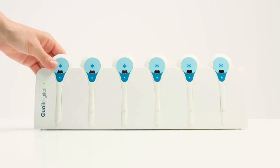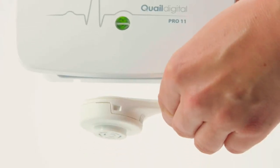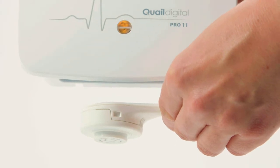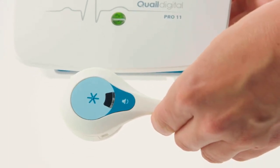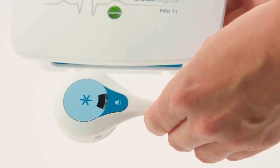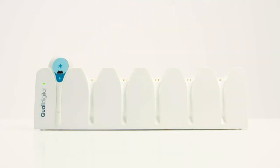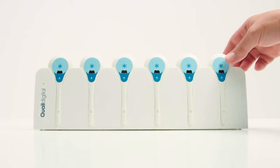Next, register all the headsets to the system. One by one, take each headset out of the charger and hold it to the bottom of the base station, facing the underside. You'll see the light on the base flash amber and then turn solid amber. At the same time, the headset light will start to pulse more slowly every five seconds. Put it back into the charger and repeat the process with each headset. Leave all the headsets in the charger for a couple of minutes to synchronize with each other and the base — then they are ready for use.